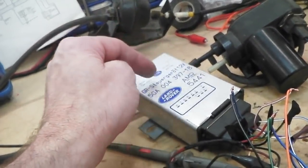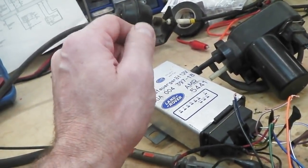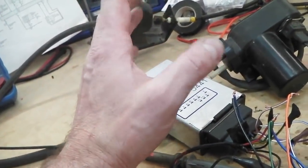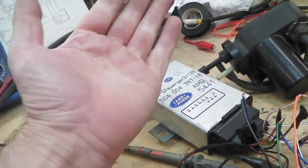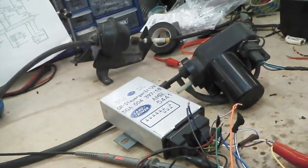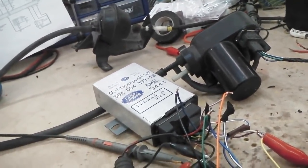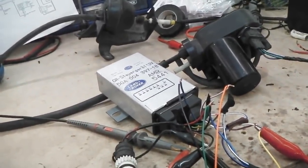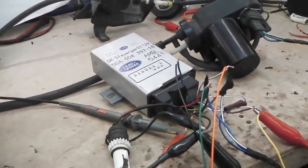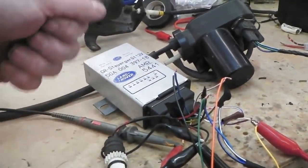And these have a resin coat, so I dip these. I've not done it with this one, but I've done them in the past on Ruby, the backup ones on Ruby, because I've got two, one spare. Both of those, I dipped them in thinners, and it dissolved all that sealant stuff, lacquer and resin, and I was able to repair the solder joints. I did find a few. Never had a problem since. You can reflow solder them. Heat gun's good for that as well.